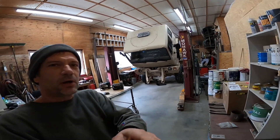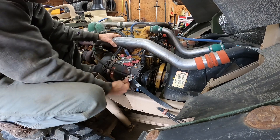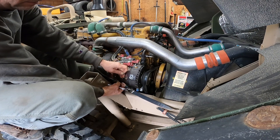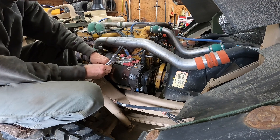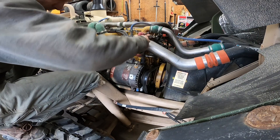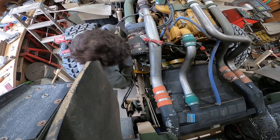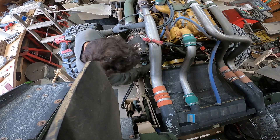I've been working on a 200-amp alternator conversion for the LM TV, so I disconnected the battery. I did some labeling on these wires, so I'm just going to disconnect everything from the alternator now and get this out of here. We have all the wires detached. There's the belt tensioner pulley and two bolts here, and it should come right out. Belt tensioner is 11/16s.